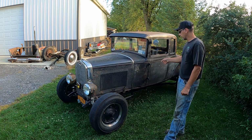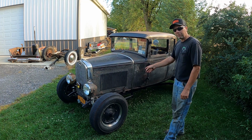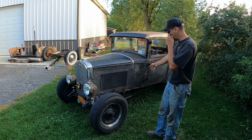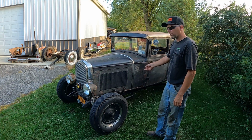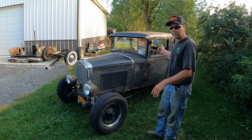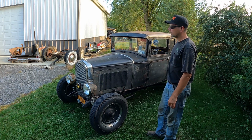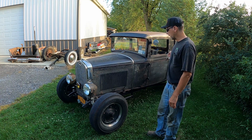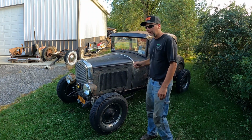And I completely rebuilt the whole car. I started with the chassis. It's got an original Model A frame under it that I lengthened by taking two Model A frames. The front half came out of a frame that was only about 2/3 of the frame, and the rear section came out from under a trailer. I combined the two. I stretched the rear 7 and 5/8 inches or so to put the spring behind the rear axle, so I could use a 38 rear axle and rear spring setup. I'll show you that when we talk about suspension.